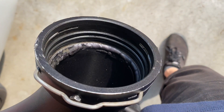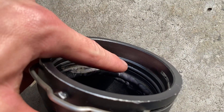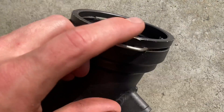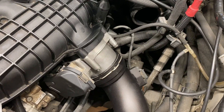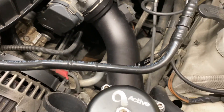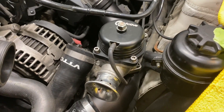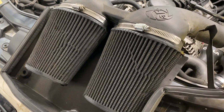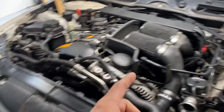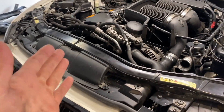When installing your charge pipe, make sure the O-ring is seated and not torn or halfway out of the seat. You also have to take the clip out to get the pipe in because that's the retaining clip. We got the charge pipe pushed on and latched, the meth bung in, and the charge pipe connected at the other end with the blow valve piped in. Now it's a matter of putting in the intakes. Got the intakes on, and I've got my radiator fan just clipped in — I'm leaving it out since I'm doing a water pump after this, so no point putting it back in fully. Time to fire it up — here's hoping we don't have any walnuts in a cylinder.